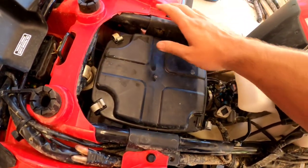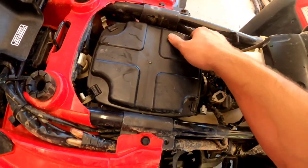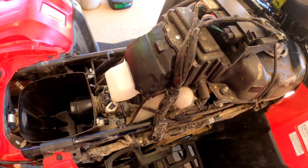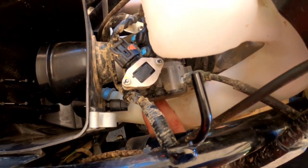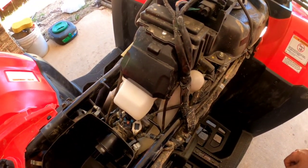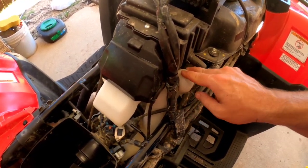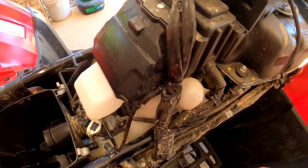The next step is to pop your airbox lid off. It's pretty simple - you just pop those tabs off, pull it up, and pull it right off. Next they have us taking the factory air duct out, which is the white plastic piece that goes into your airbox. I'll probably post a picture with arrows pointing to what you need to take off to get this out.